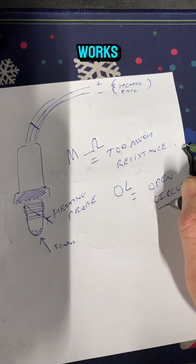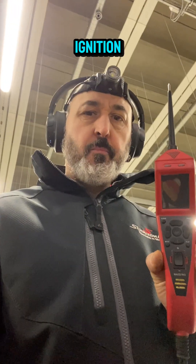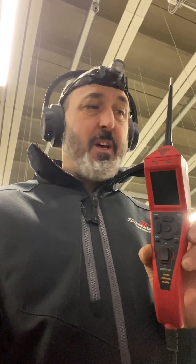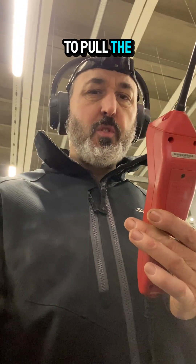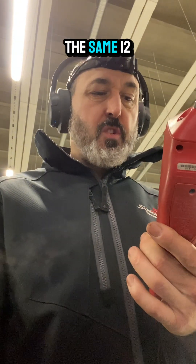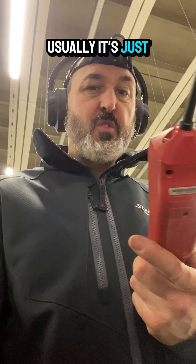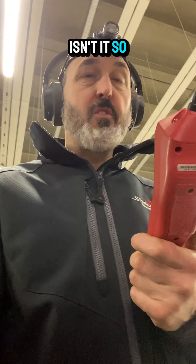Let's get on to diagnosing it. I'm going to get the power probe, go under the car, check the circuit plugged in and back probe it with ignition — we should have 12 volts there. The reason I'm not checking the fuse first is it's a nightmare to get to, beyond the glovebox. It's easier to pull the trim off and plug this in. Both sensors have the same 12-volt supply from the same fuse, so for both of them to fail is unusual.